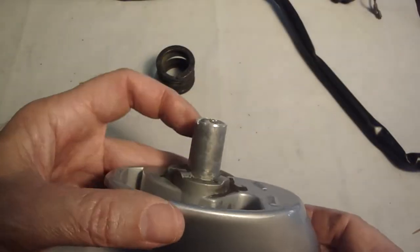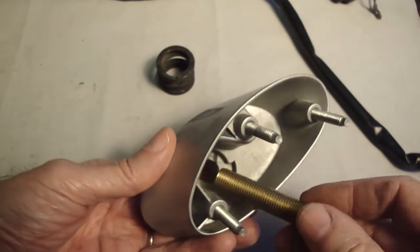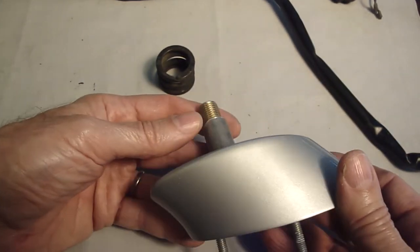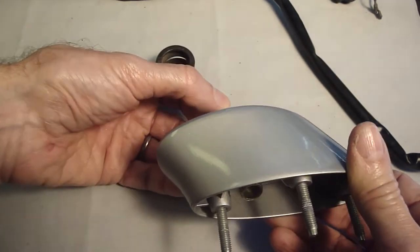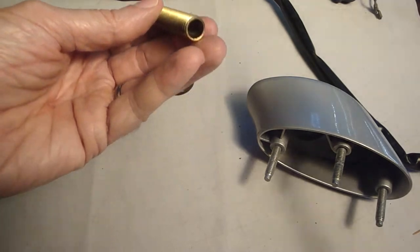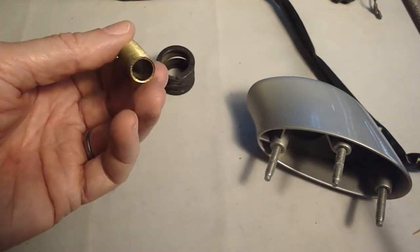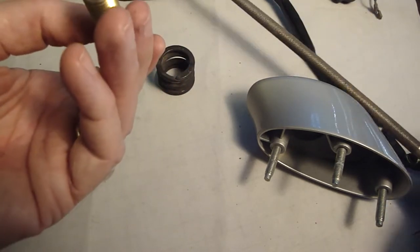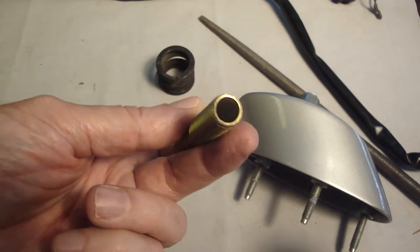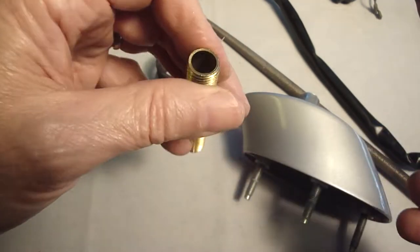Okay, I've got the pedestal ground down and I filed the slag out of the center. So the lamp nipple fits through. I also took the rat tail file and started filing out the center of the nipple, not only to smooth it out, but just to give me a 1/1000th or 2/1000th extra space inside to have room for the wires.